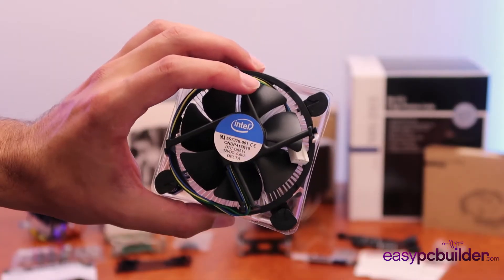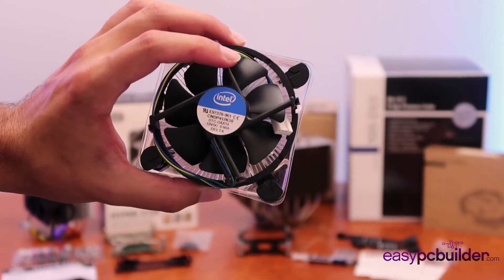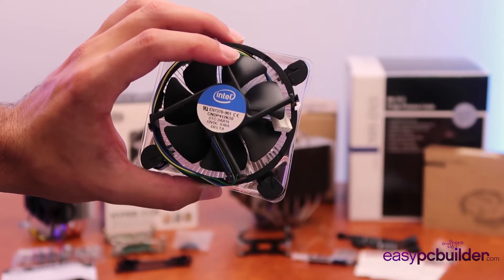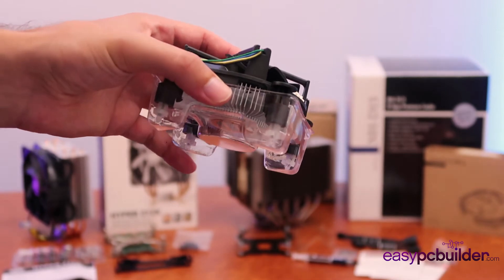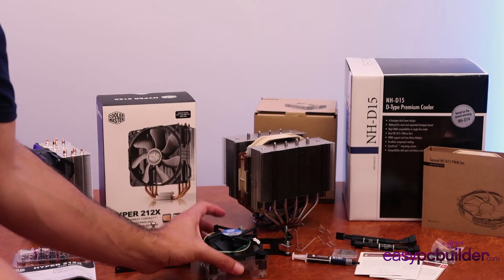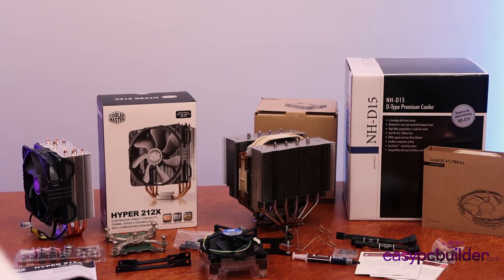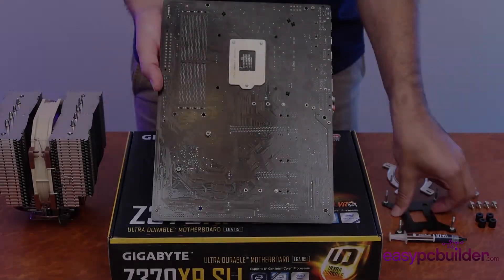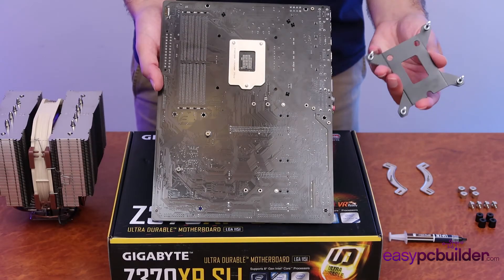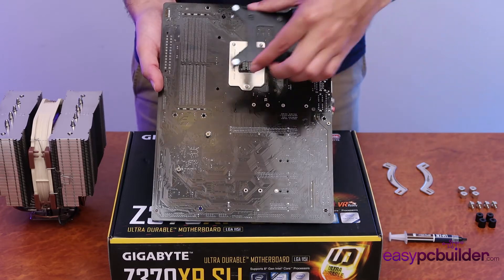A small CPU cooler with limited surface area can only increase the fan speed so much in order to control temperatures, and when the limit is reached the CPU will begin to limit its processing and heat generated to ensure it doesn't damage itself. If you are keeping a CPU within manufacturer specifications, a stock cooler is fine, but where you tend to overclock it, increasing the speed and hence heat generated, you need to upgrade to ensure you don't hit this thermal limit.